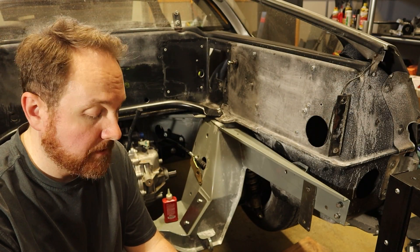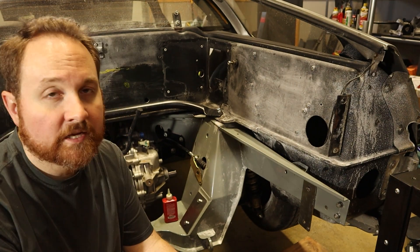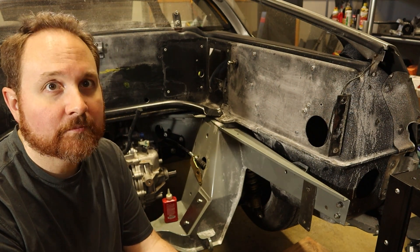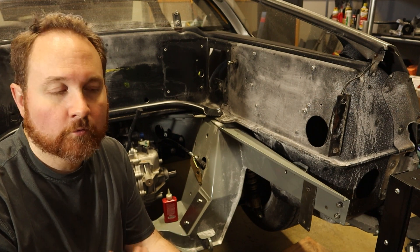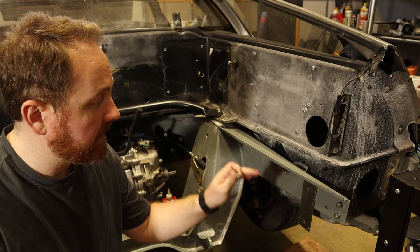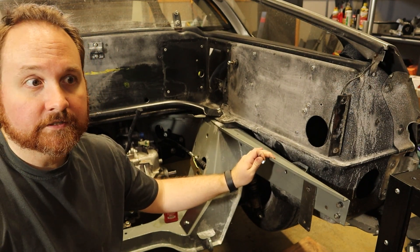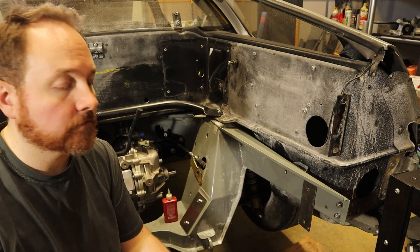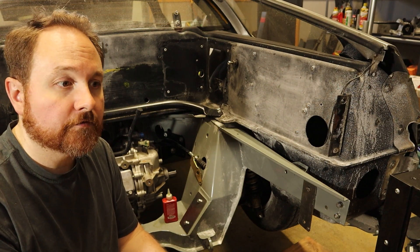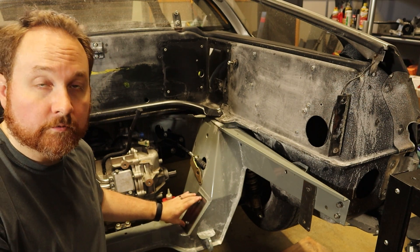The first important task with mounting the rear battery pack is figuring out some mount points on the frame. I'm trying to make this entire EV conversion bolt-on, so I'm limiting myself to putting a couple of holes in where needed, but not welding to the frame at all. My frame is an aftermarket frame made out of stainless steel to prevent rust, and welding stainless to mild steel is kind of difficult. So I'm also trying to reuse as many existing mount points on the frame as I can. Right here are the mounts for the original engine mounts.